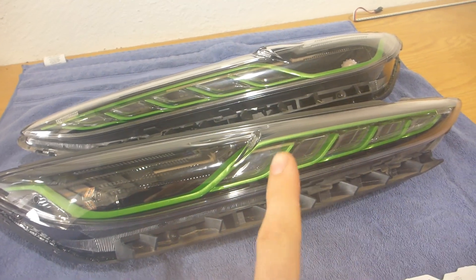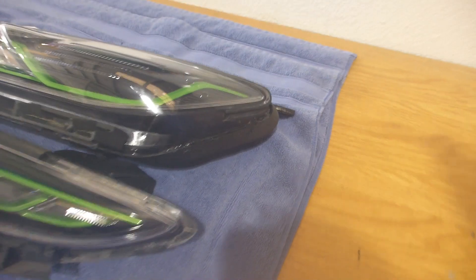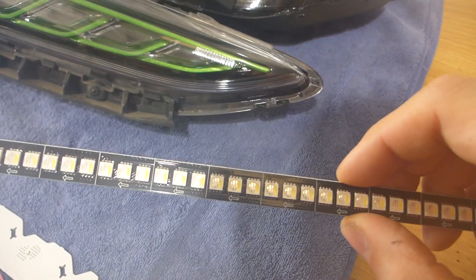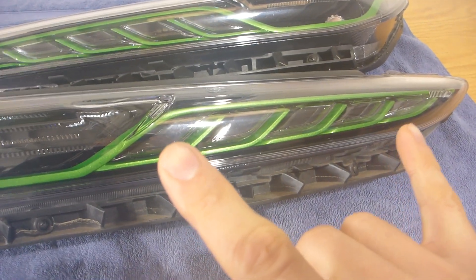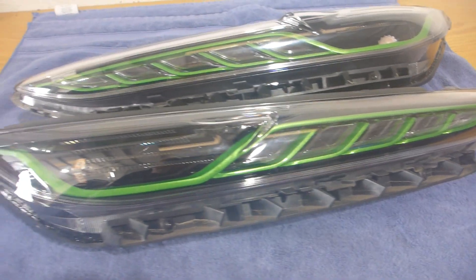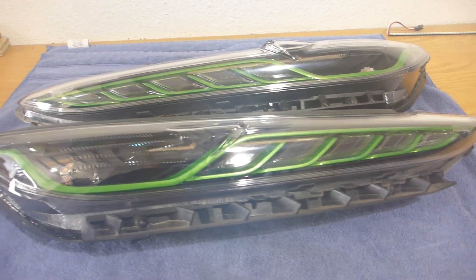In addition to the paintwork, I removed the factory DRL board and the factory DRL driver, and replaced them with UCS LED strips. I chose the 12mm, which is the super wide one, because of the heat dissipation capabilities. This is an addressable RGBW product that I got from Next Level Neo that goes along there, and it will still allow me to have a white DRL mode while driving, but it'll also allow me to do start-up and shut-down animations via the Blue Ghost and any color-changing moving effects I want to do.